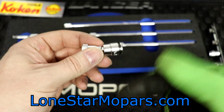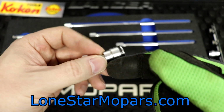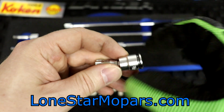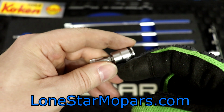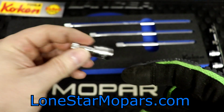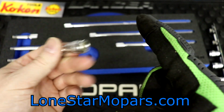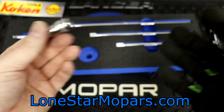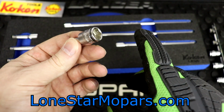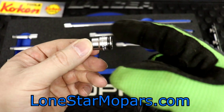Like if we're dealing with headers, which is what I've got on my mind right now, if that primary is kind of rubbing the sidewall of the socket, that's another cool thing. That spring steel is recessed. It's not sticking out and increasing the diameter. So we've got an OD profile that's great, but the catch is, so many times when you're doing it by hand, if I'm not constantly applying forward pressure to the fastener, to the sidewall of the cylinder head, this is just going to drop off because the primary's here and it's just how it works, gravity, all right? So what this allows you to do when you utilize the nut grip, especially since it's not recessed super deep, is the holding function, it's right where you see that spring.